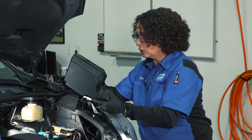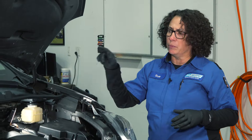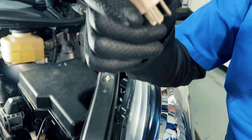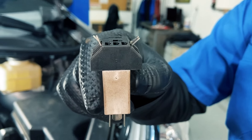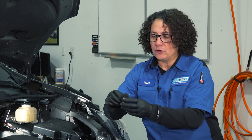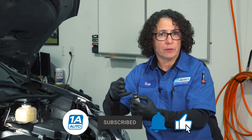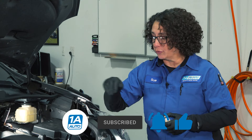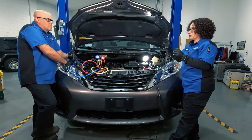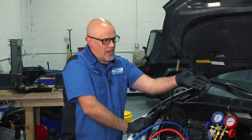You're going to check for power at the fuse. If you have it, check power at the relay, with the button going on and off. If you can use a jump connector — they're really inexpensive — you can plug that into your fuse box and then put the relay on top. It will also tell you if the relay itself is any good, because then you can check for power in and out, grounds, and the switch toggling. That's a quick way to find out if you need a relay, which is pretty common, or the actual circuit unit itself — the heater control unit. The circuit board could be fried inside, or even the wiring from that too.